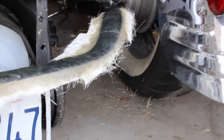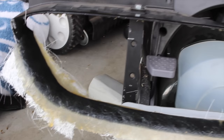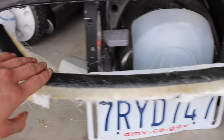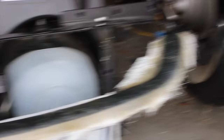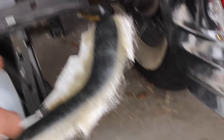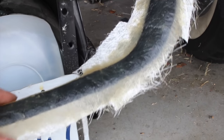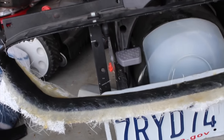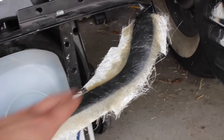So as you guys can see, this is the way that the fiberglass laid up. It's all dry now, and yes, it's supposed to look all wavy like this. You just have to sand that down and then put bondo on it to make it smooth. This is literally one layer and it came up nice. I'm going to build more up on the sides to make it more flowing. What I'm going to do is sand this a little bit now to scuff it up so that the resin has something to adhere to, and then I'll be laying down the second coat of fiberglass.